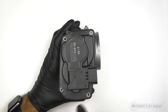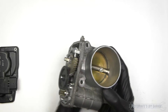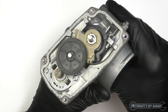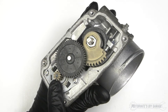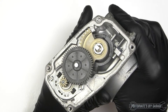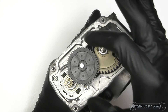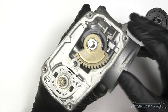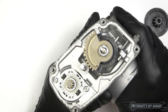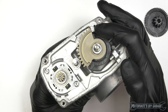On the top, I've already removed the four screws, so let's pop off this cover and have a look. Here we can see the general operation of the throttle body. This is the gear that's on the small electric motor, and this gear has to turn about four and a quarter times from fully closed to fully open. That's fully closed, and that's fully open.